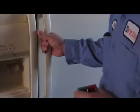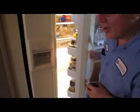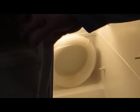To find out, I'd open up the refrigerator — I've removed some of the crisper shelves here. If you notice the coil down there, that's where the water is stored. Water comes in at the bottom coil, fills the coil up, and sits there. If your refrigerator is at 40 degrees, then your water will be at 40 degrees.